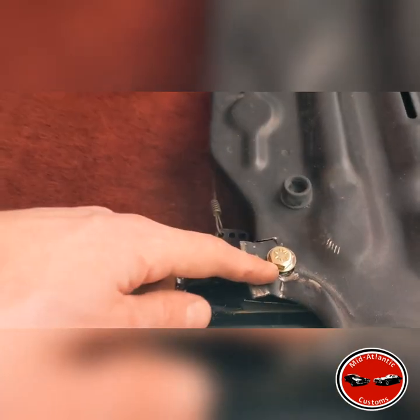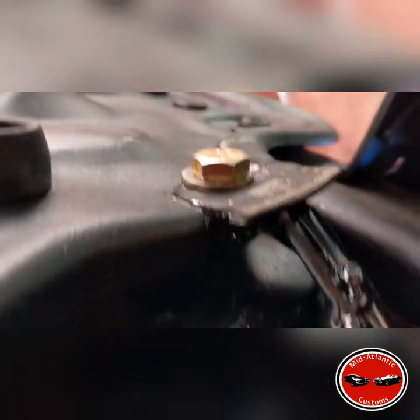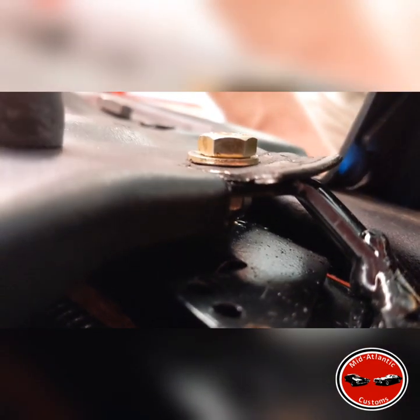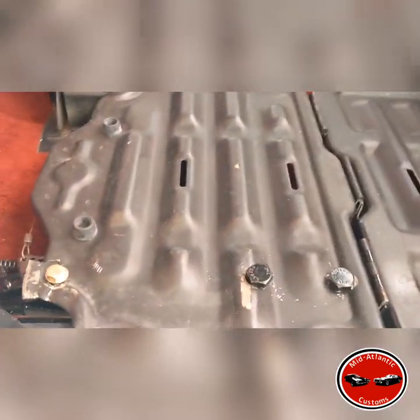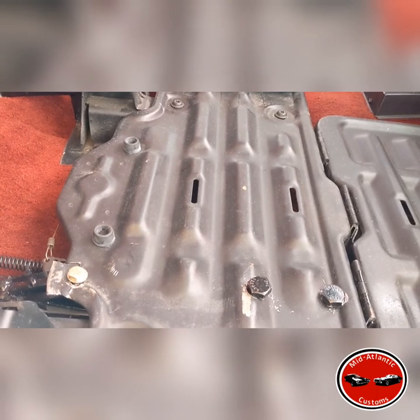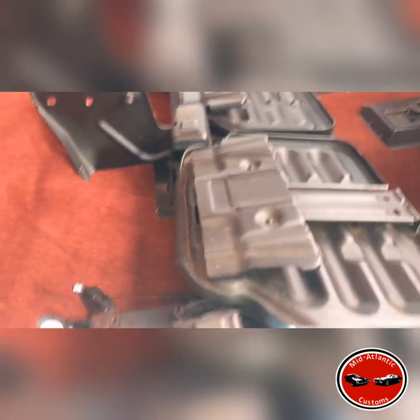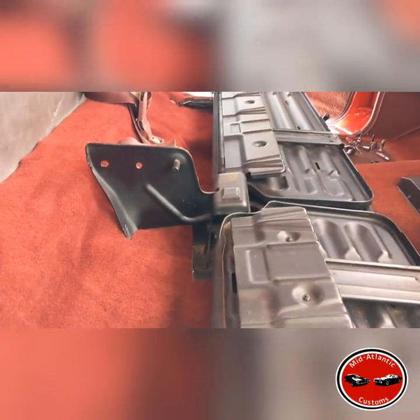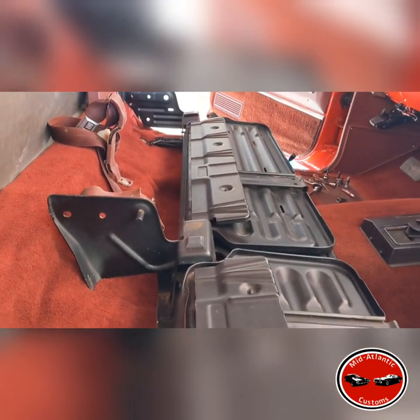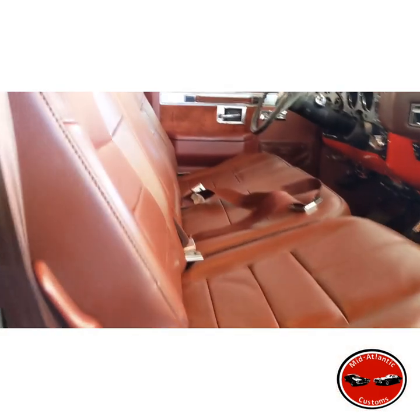I tapped all the way down through the bushings and the track, welded everything up, then placed the rear bracket where I wanted it. I put a lock nut on the underside — it's kind of hard to get to but nothing too crazy. I reinforced this portion as well, and I think things are good to go. I'll get the seats in, get everything bolted up, and do an update once I have everything back together.